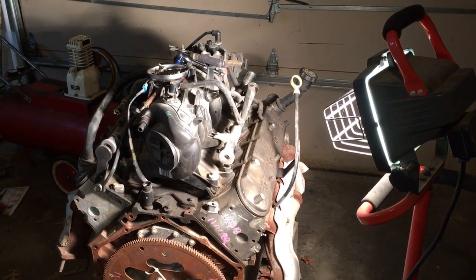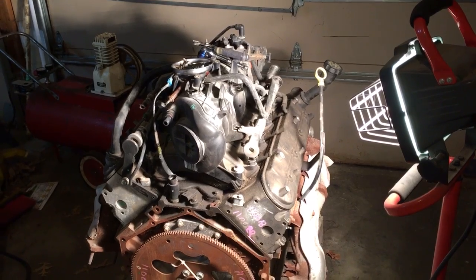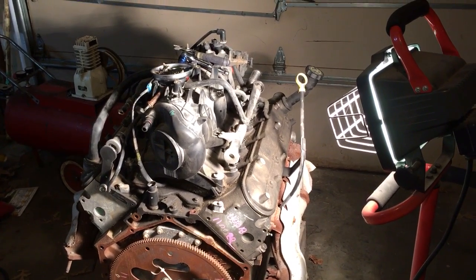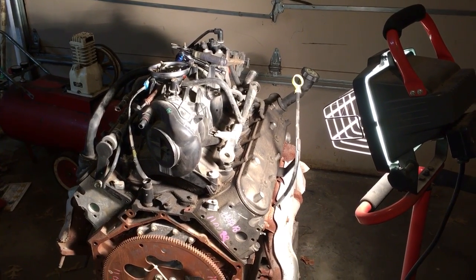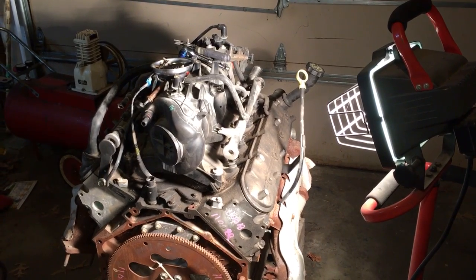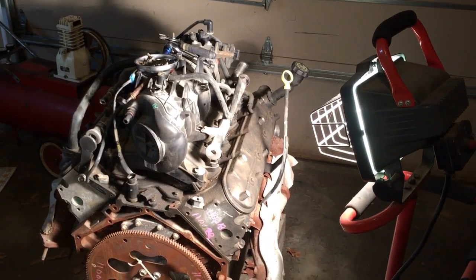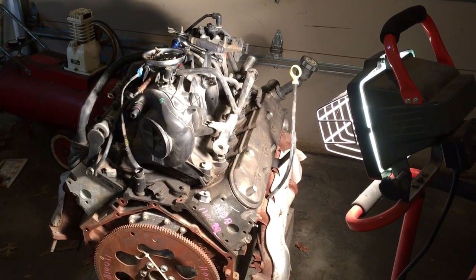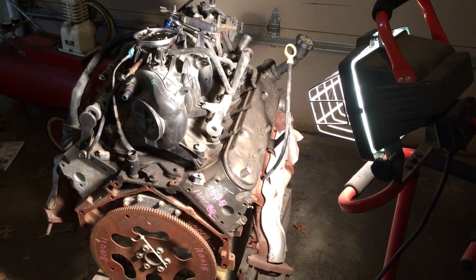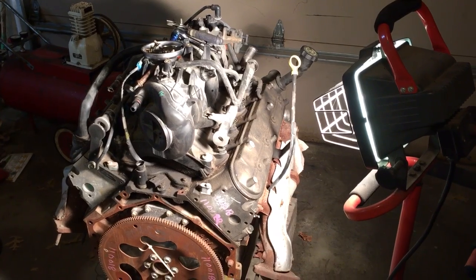Basically it's going to be fed by a 69-millimeter 50-trim turbo. I don't even know the brand yet — we'll make a different video on that — but I have two of those left over from when I was building my twin-turbo big block and I decided to just run one on this LS because I want fuel injection. Originally when they were purchased they were supposed to be 76-millimeter eBay turbos, but after I pulled them apart and measured everything they were actually 69 millimeters. I think it's a 0.96 AR exhaust housing — different video, different time.